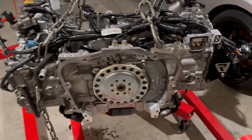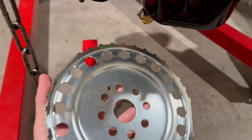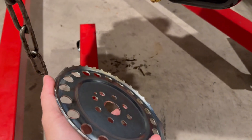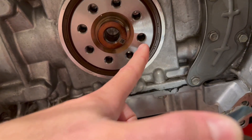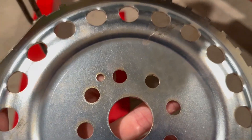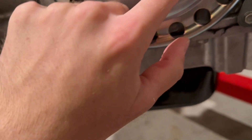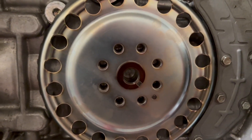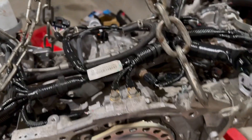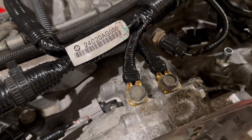Something important to note when putting this plate on: the flywheel goes on over it, then the pressure plate and clutch disc assembly. There's a little pinhole in the back of the crankshaft and a pinhole receiver on the plate — you just line them up and put it right on there. That's how you get your timing correct systematically. On top there are two wires, and I was able to look at the manual to find where they go.